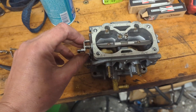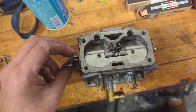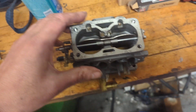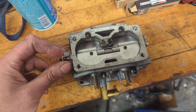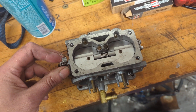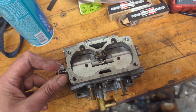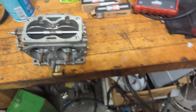The motor still has carburetors. The old choke would actually cut the air off — when you cut the air off, it draws more fuel in, causing a higher amount of fuel to enter and start the engine. Two-strokes need a shot of fuel to really start up, and so do most four-strokes. That's why they kept the term choke.